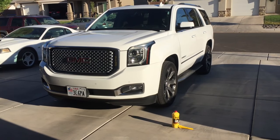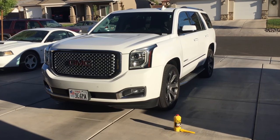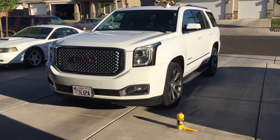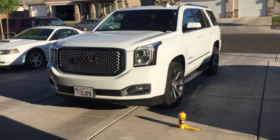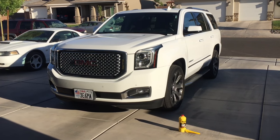I did start with the passenger side rear wheel first, which is farthest away from the master cylinder, and for that I just slid under and bled it. But to show you the process, I'm going to remove the driver side rear wheel — just in case you are going to be removing the wheels for this if you don't want to slide under it. So I'll show you that process and what it looks like from that angle, and then we'll jump back under the front without jacking the car up.